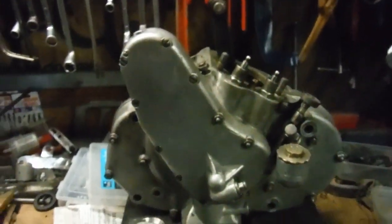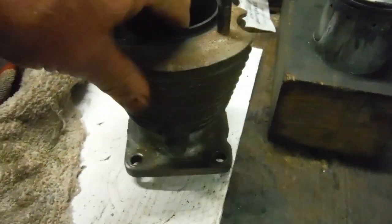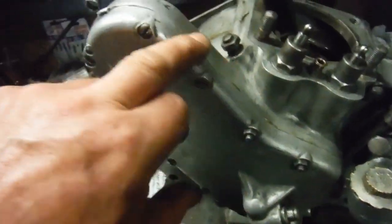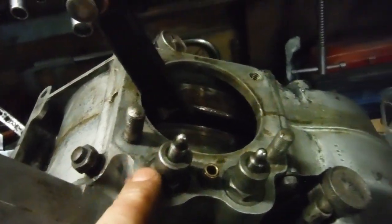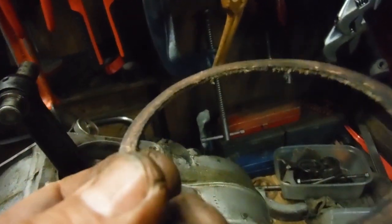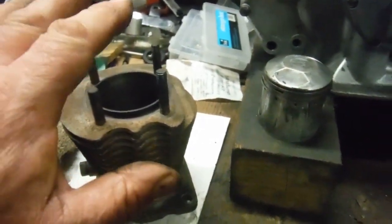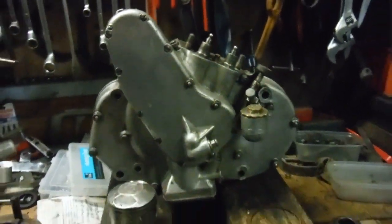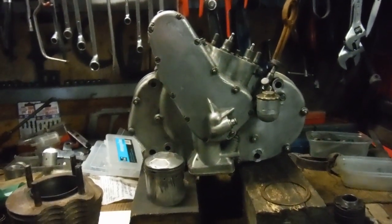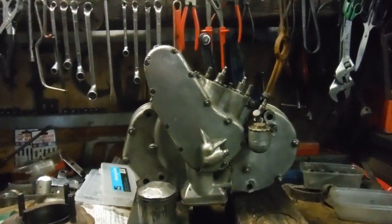The only thing I haven't checked yet is the condition of the valves and valve guides in the cylinder head. I also need to speak to the owner about whether he'd like this blasted and painted, and likewise the head. Basically it's going to be a straightforward reassembly — I've made a gasket for the timing cover, I'll need to make one for the cylinder base, and there's a head gasket and a copper sandwich ring which can be re-annealed and used again. We can build it up to cylinder head level and everything will be quite serviceable. At worst it'll only be a matter of dealing with valves, guides, and valve seats — we'll find out in the next installment.